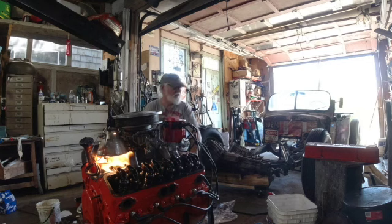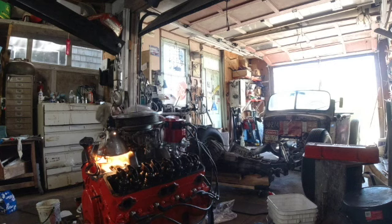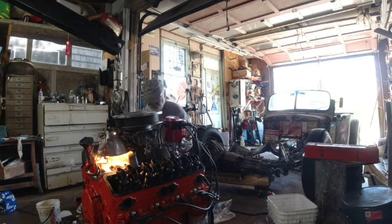I went and bought the book, put the wires where they go, but I could have made a mistake, and you don't ever want to rule that out. Another thing that's going to happen is timing is going to be an issue. You know, I might need to do a little twisting on the distributor.